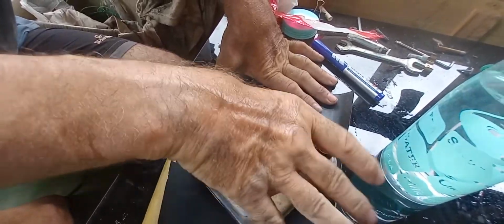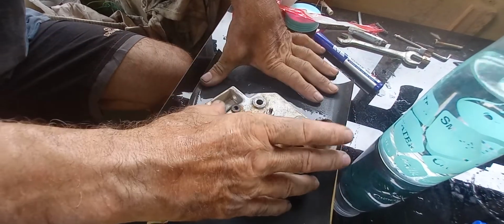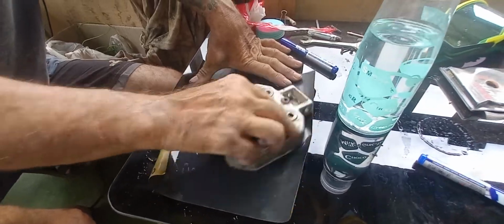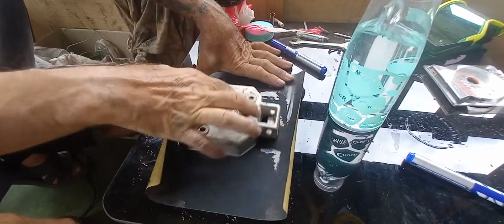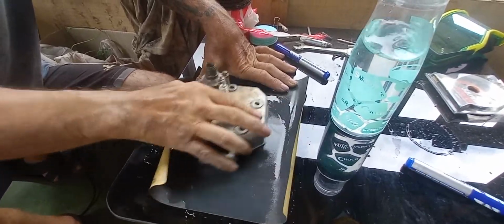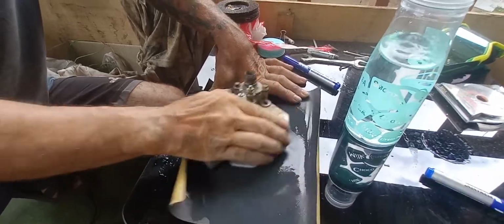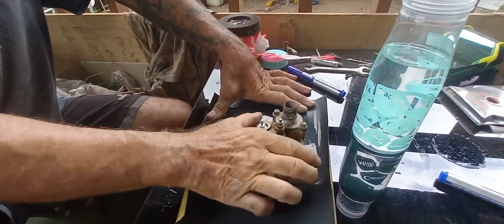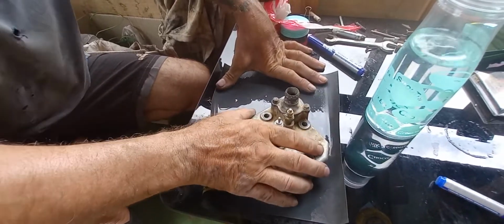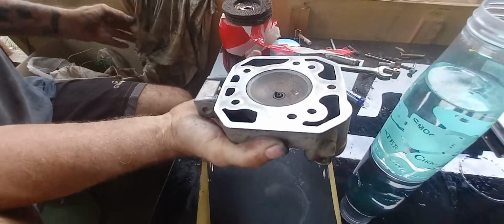And don't push down on any particular corner while you're doing this, because you're going to force more material off. Not that you're taking off much anyway. Just slowly rotate the head around while you cut. And this is really boring. You could be doing this for like 5 minutes. Right, pause that there, Minitron. 5 minutes later.